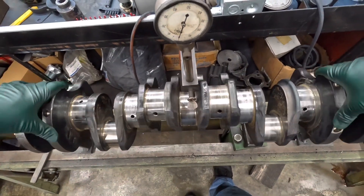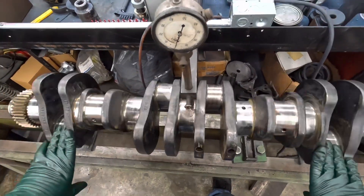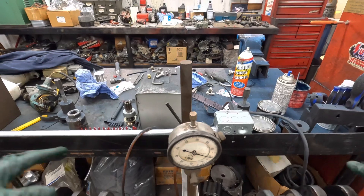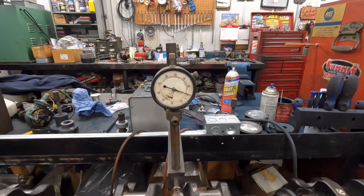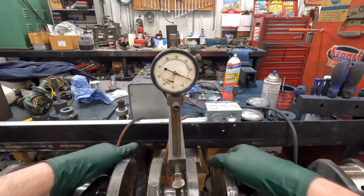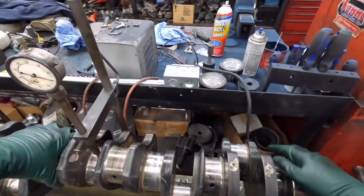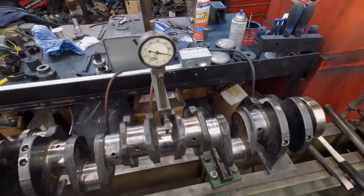Is that the low right there? I'm within one. I'd say we got it. We're within one — like I say, that main could be out of round too, I didn't mic it, but that's well within grinding specs. There we go — we got it straight within one. We'll go ahead and take it to the grinder and see if we can't save this old 5.9 Cummins.